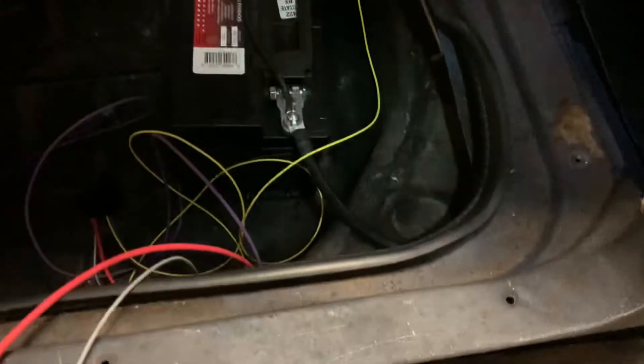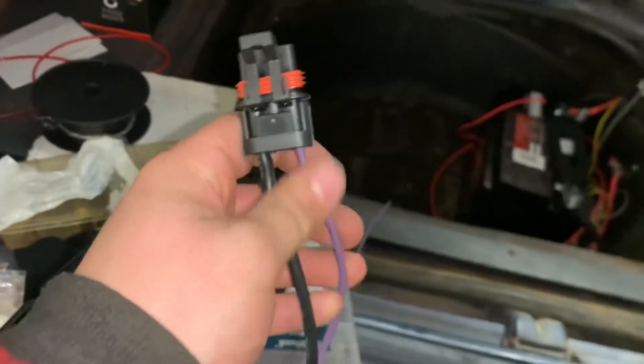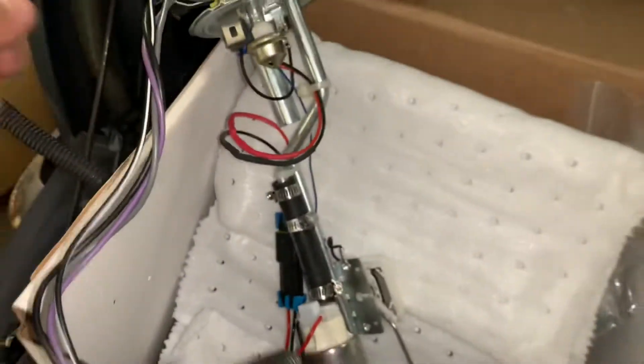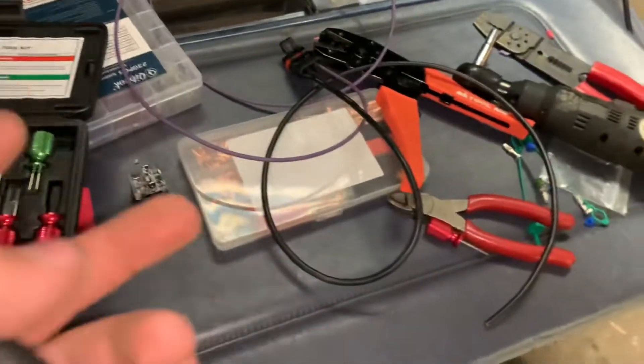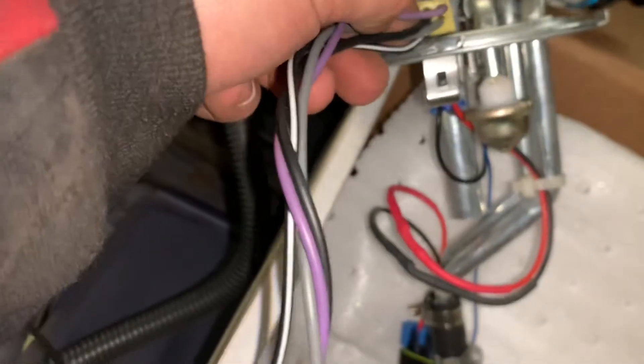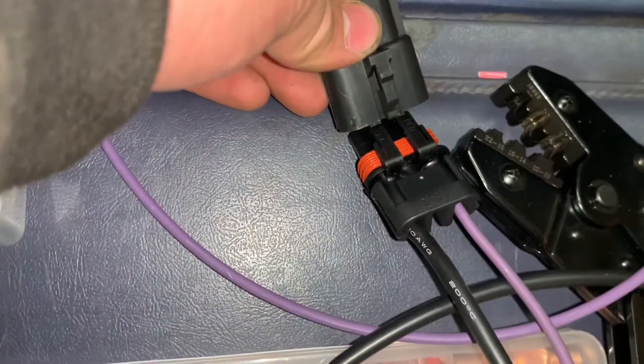Little update on the electronics. I got the fuel pump pretty much ready to go back in, I just gotta make lines for it. I accidentally pinned it wrong the first time because there's a purple wire - but the purple wire is actually the ohm sender, so I could add that to my screen to see fuel level. The gray is power to the pump. So I got gray running to the purple, and it's got a dual ground - black with white stripe is the pump ground.